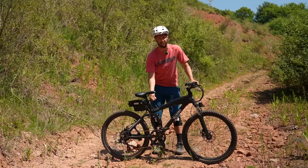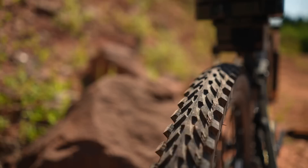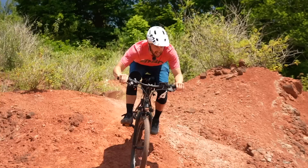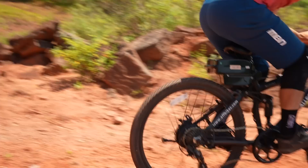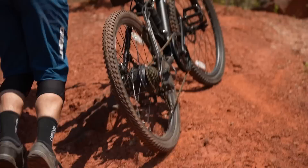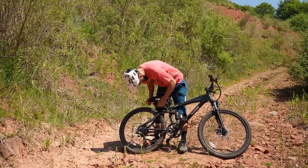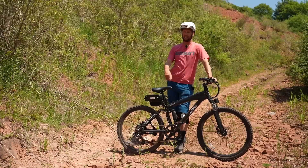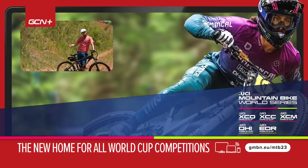Status report, damage report, if you like. At the seat, it just spins around now because it doesn't stay up. Both the brakes are warped — they're fairly bent. Mega surprise I didn't get a puncture, to be honest, because we've got tubes in them, but I pumped them up to about 35 PSI, so that's probably why there was no grip but no punctures at the same time. The biggest problem: it didn't snap, which is 100% what I thought was going to happen, and I didn't end up with a fork spring in my eyeball either. The over-engineered gussets actually kind of worked. It was dreadful on the uphill — just underpowered. The biggest problem is the back end's essentially collapsed: the rear shock's shot, and the battery wiring underneath is just banging on the back tire all the time. It's worn the bolt away, split the casing, and it's starting to puke out a bunch of wires. Give it much longer and that would definitely be the first thing to go.